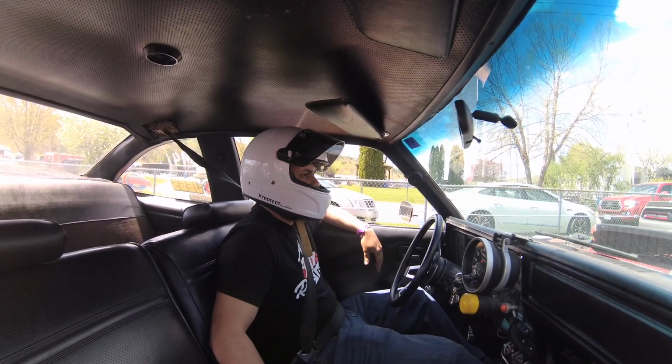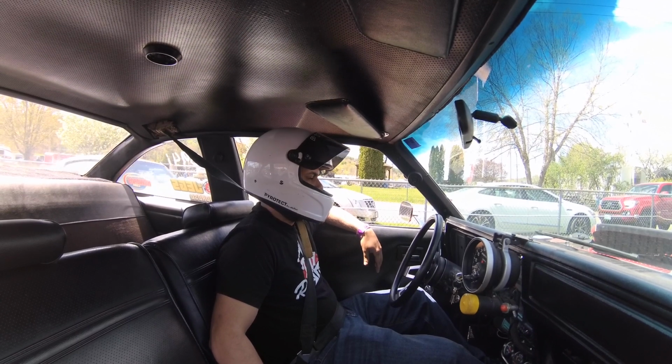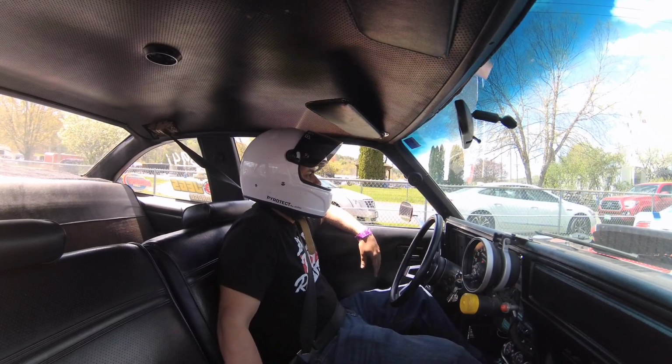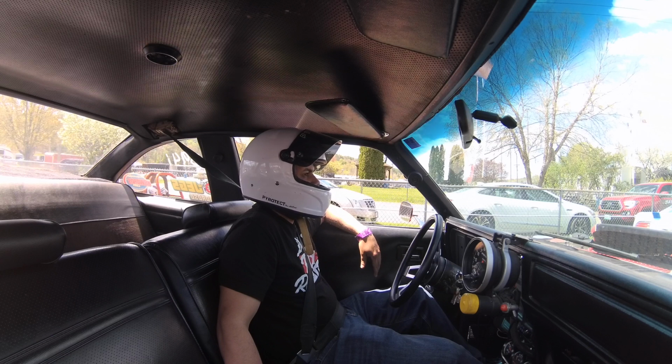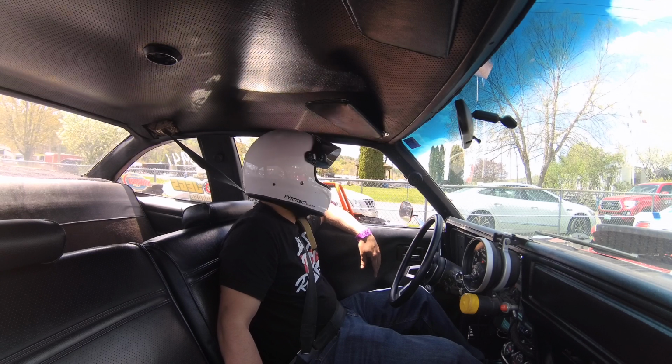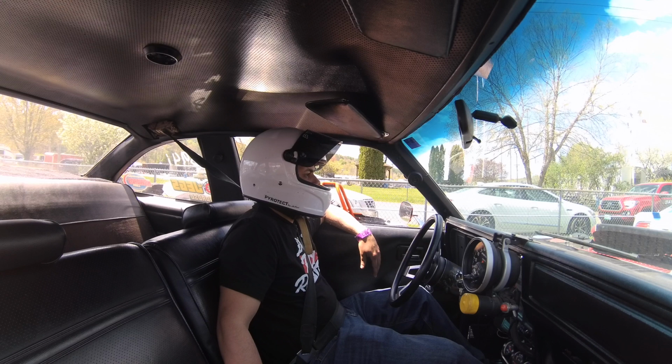I am also very impressed with the combination. This is recorded a couple of days after, and this thing is making a lot more power than I originally anticipated. Again, it went 11 seconds with only 23 or 24 degrees of timing in it, so it's gonna go pretty quick just by upping the timing. Toward the top end, I could feel the car struggling a little bit, and I backed off of it too. So that's why the miles per hour is a little bit on the low side for a mid 11-second pass.